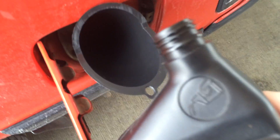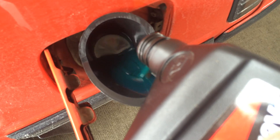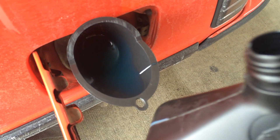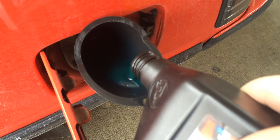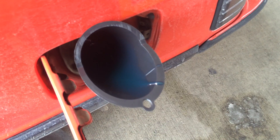The little tips of the triangles that are rubbing and bumping against the housing all the time need lubrication. The stock system wasn't very good at it, which is why engines blew at about 80,000 miles. So that's just kind of what pre-mixing is if you're just getting into rotaries.